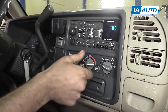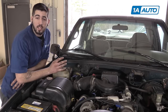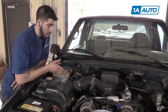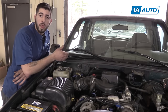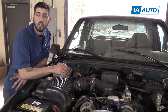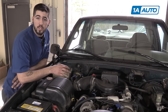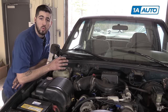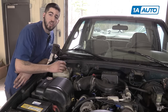I also have my heat on full blast. We'll either have a decent flow that's still allowing heat to be taken out of the heater core, which will bring one hose hot coolant into the heater core and cooler coolant out of the other side. Or if our heater core is clogged, we'll have hot coolant on one side and an ice cold hose on the other. This will tell us which is inlet and which is outlet, so we know how to back flush it correctly.